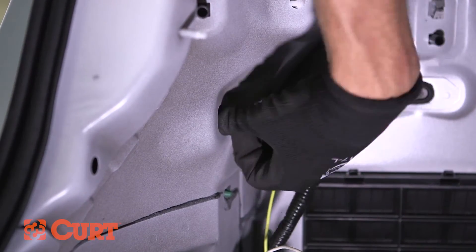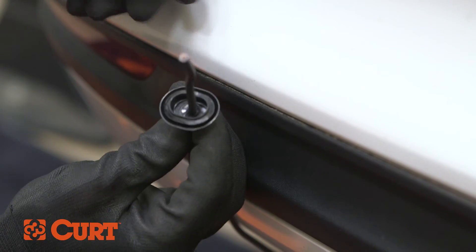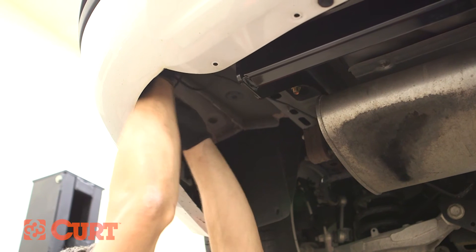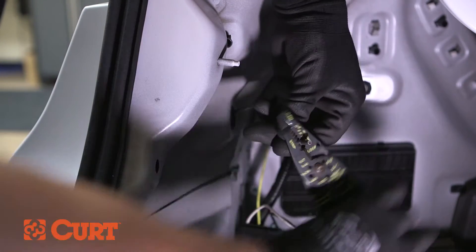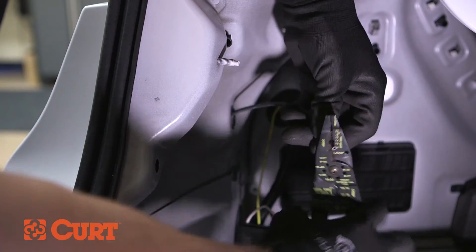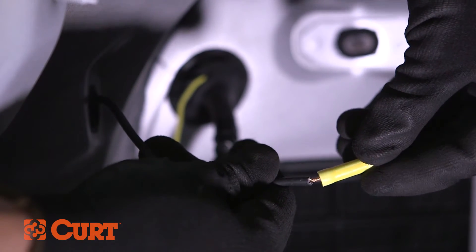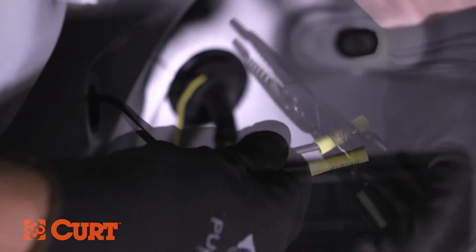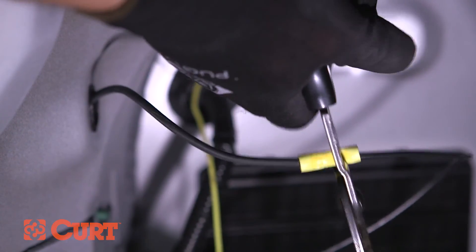From inside the trunk area, locate a small grommet near the large grommet that was previously removed and cut. Route the black power wire through this grommet from underneath the vehicle and into the trunk area. We recommend using a utility knife or drill to customize the grommet. Route the black power wire up inside the vehicle, through the grommet, and out into the trunk area. Re-seat the grommet. Trim any excess from the power wire and strip and twist the end. Slide a yellow butt connector over the stripped end and crimp it to the power wire. Insert the black power wire from the black converter box into the other end of the yellow butt connector and crimp this section together, making sure a strong connection has been made.